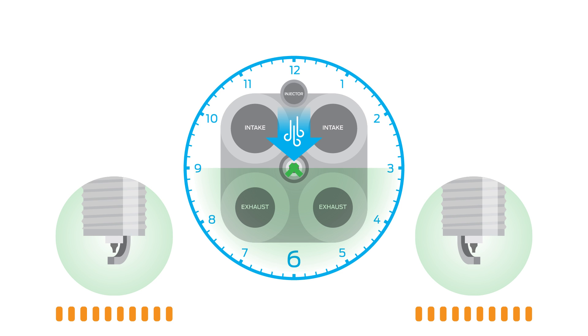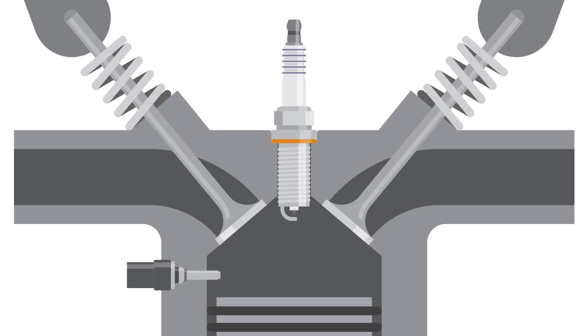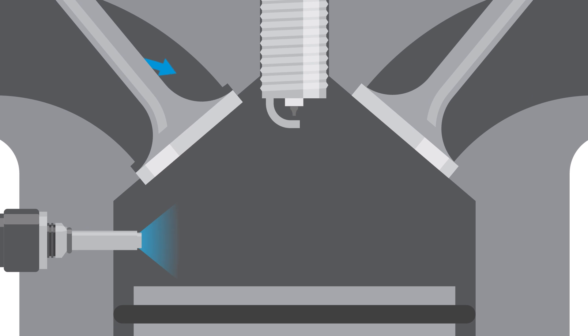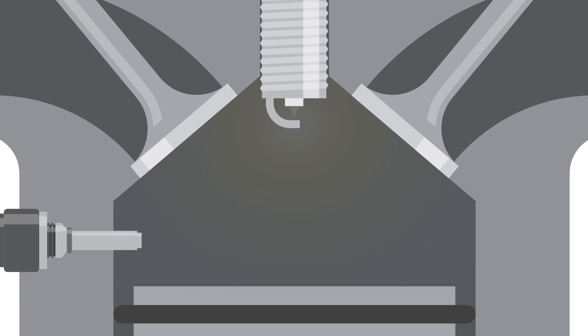The best spark plug positions for energy transfer were determined by engine dynamometer testing. Engineers and designers found that the best tolerance is biased towards the 6 o'clock side of both 3 o'clock and 9 o'clock. These are mirror positions and they basically perform equally well. But tests showed that the energy delivered drops off much more quickly when the plug is approaching 12 o'clock than when it's positioned towards 6 o'clock. This is related to the incoming airflow, which hits the reverse side of the indexed spark plug when it's positioned right at 12 o'clock, impeding its performance.